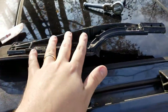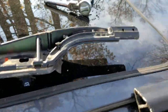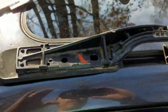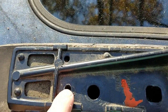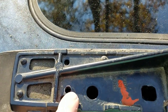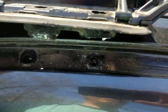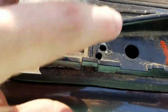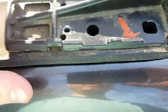The next step is you're going to need to modify the RAV4 mounting points so they'll fit on your Sport Cross. I'll go over the fronts and the backs — the fronts are a little harder than the backs. From the top it's really easy; all you have to do is drill one hole. You can cheat by finding the little plastic circle that's already OEM there, go a little up and left from there, and drill your hole in. The front hole lines up with that, and then the new hole you drilled will line up with that.